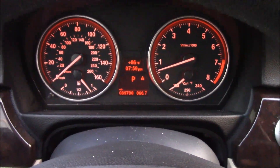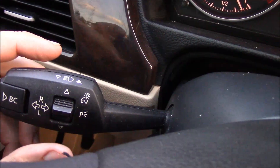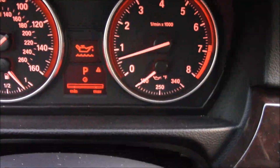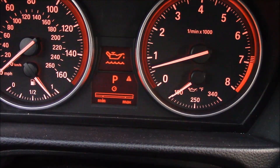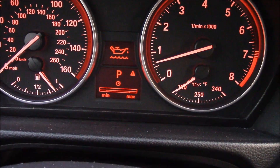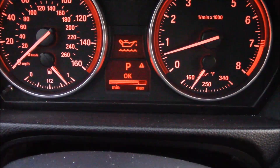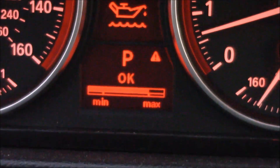Another unique part of this car is that it does not have an oil dipstick — the level is read by the computer. To check the oil level after filling up, push this button a couple of times until it gets to oil, then push this button and it will read. You have to drive a few miles first, so I took it on a quick test drive. After about two miles, we're reading up to the maximum line, so we're good and don't need to add any more oil.